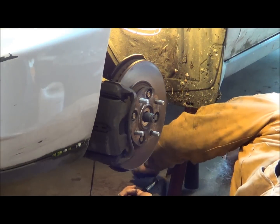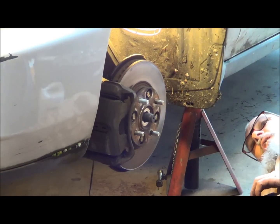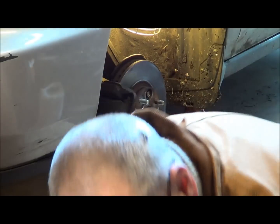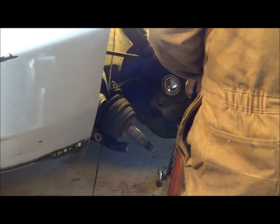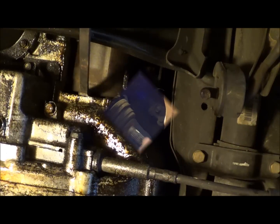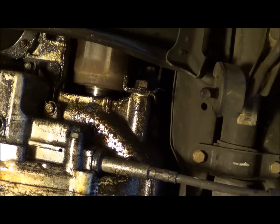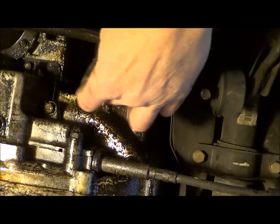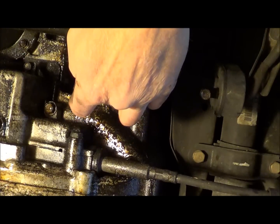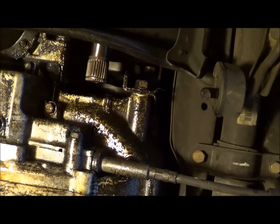Theoretically now I can take this all apart. Just kind of hold that back out of the way and pop it loose inside there. What you have on the splines is a little round snap ring, and that's what you're popping loose when you do that. Now we're going to pull this axle out of the hole, grab the new one out of the box, and make sure it's the correct one before I put this back.